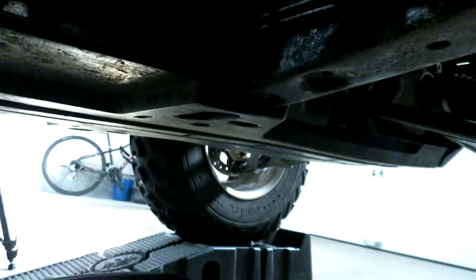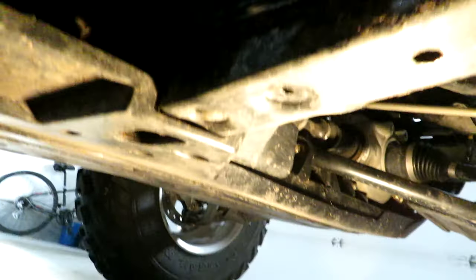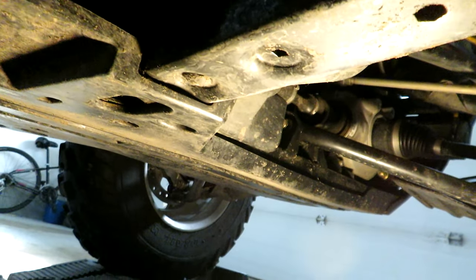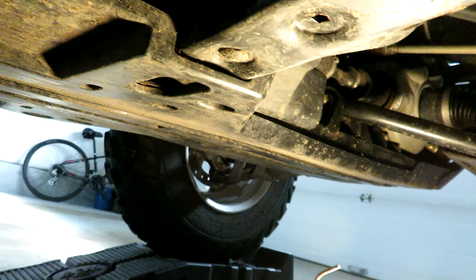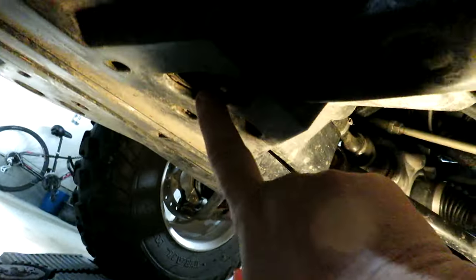Okay, I'm underneath the Can-Am here. Let's get some light under here. And the first thing I'm gonna do is drain the oil out of it. Now, I did run it for a bit to warm up the oil, and the drain plug is the most forward large hole on the shield here. It's real difficult to see, but there is a 13 millimeter plug in there that needs to come out. And I got my pan under here to catch the oil,